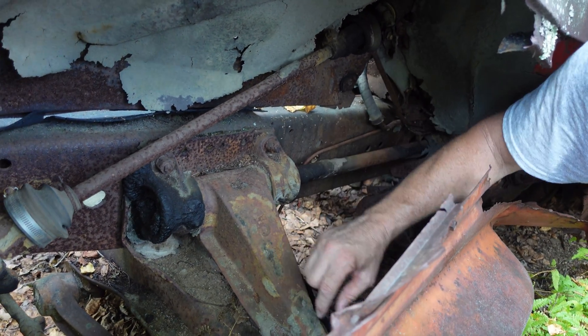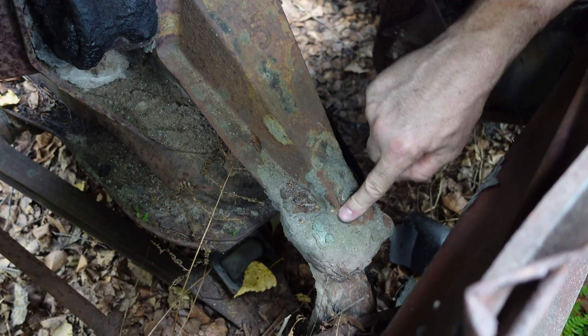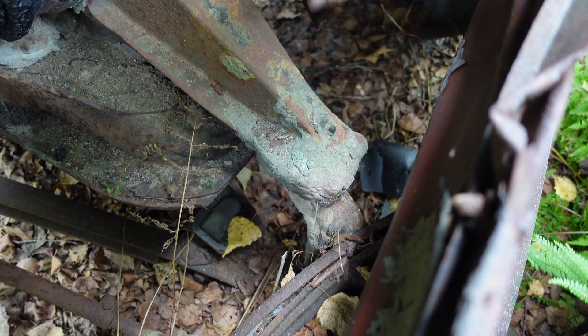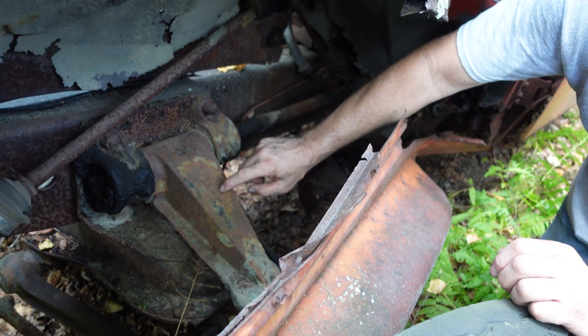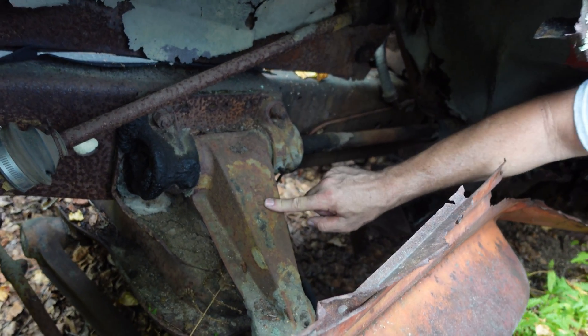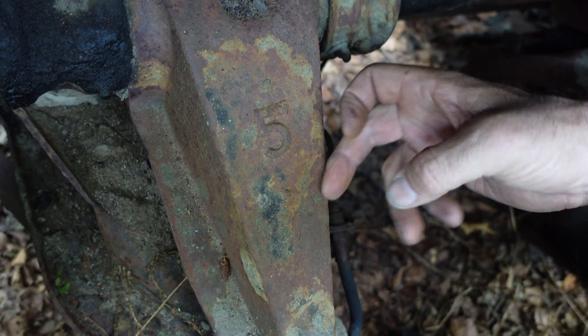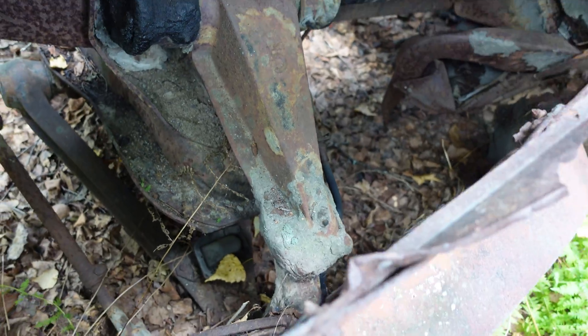These don't have kingpins — they have massive ball joints, which is kind of weird to think there's a ball joint inside of that, not usually associated with heavy-duty stuff. This one is a heavy, heavy piece. These were also available in half-ton pickups, but that five cast into this thing tells us this is a five-ton item, probably for assembly line stuff. The pickup trucks had a stamped steel piece, but that's a forging — the five-tonner for the heavy duty 60 series truck.